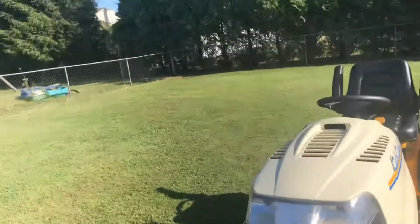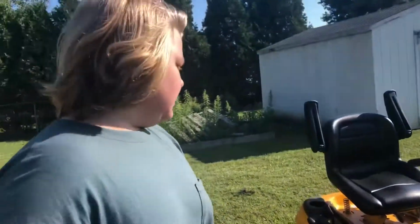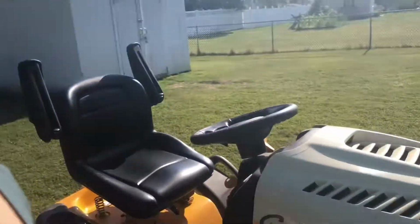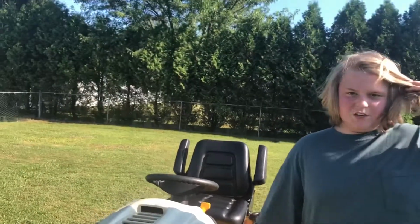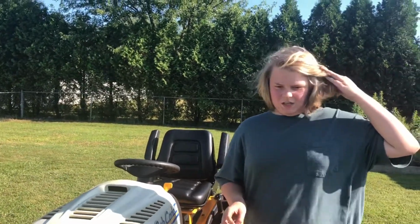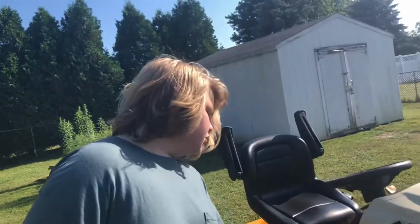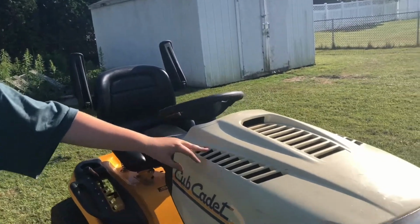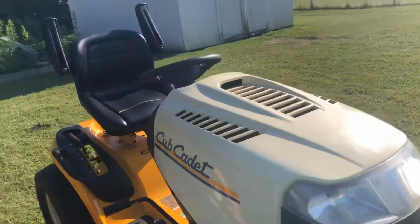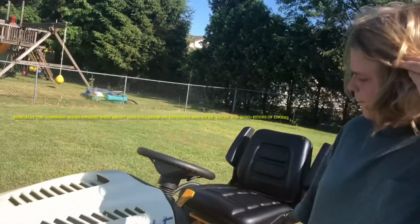So the difference between the two motors was, back when these were made, generally, most of the time, the Command Series engines cost a little bit more money, and the Kohler Courage series were cheaper. Kohler Courage singles had issues. The V-twins, in my opinion, I think were good motors. The Commands had a little bit better quality control though.